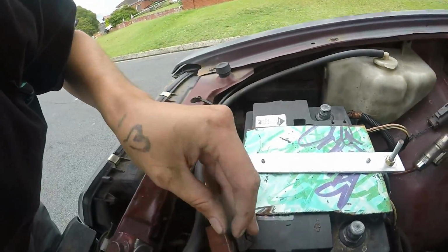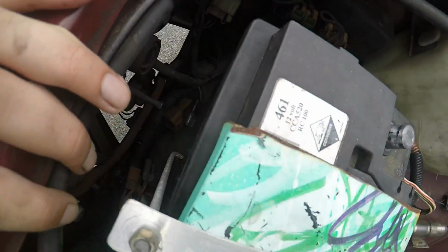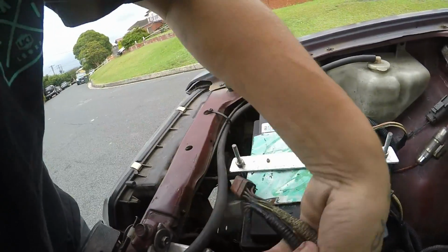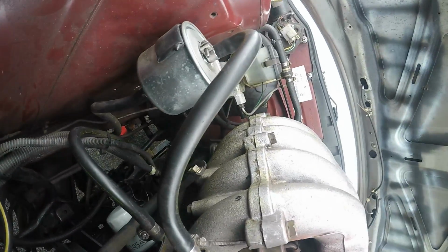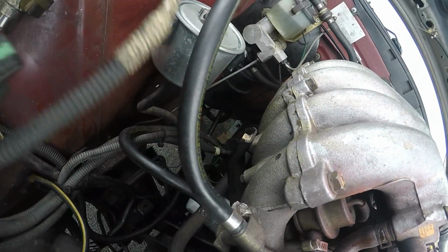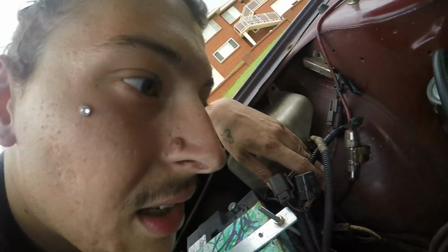wait, what? The wires plug in behind the battery in your engine bay and run on a 2-meter long loom. Meaning you don't even have to mess around underneath the gearbox at all. You just unplug the plugs in your engine bay, unbolt your gearbox and tail shaft and pull it out.